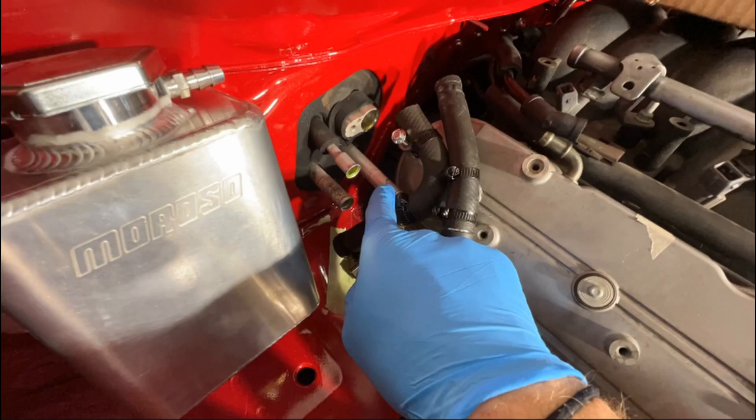I made the mistake of filming a time lapse while I was explaining something. What I was basically explaining is that you want to route your heater core hoses correctly. The inlet to your heater core inside of the car should be the bottom. So the outlet of your water pump heater core port should go to the bottom of your heater core in the car. The one I'm pointing to in the screenshot — it looks like it's above the other one from the engine bay, but if you look inside the car underneath the dash, that one actually enters the bottom of your heater core. You want your coolant entering the bottom to help bleed it — if it enters from the top it could create air pockets and ultimately your heater core could have a huge air pocket in it. It just makes it easier to bleed and prevents any issues later on down the road.